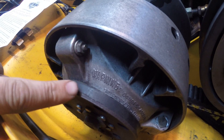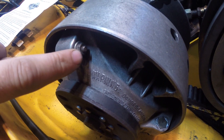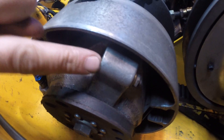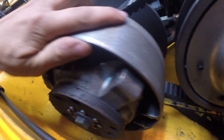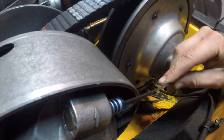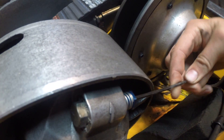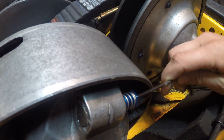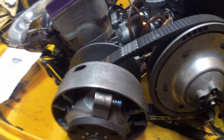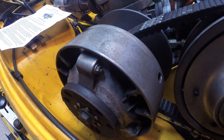These are on a bolt with a nut on the end, so what you'd have to do is back this nut off — not all the way — just so the top of this comes out, and you can then spin it to the number you want. But with these quick clickers, what they allow you to do is put an allen key in, push it out, adjust, and it'll come right back, just like that.